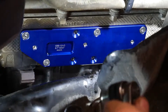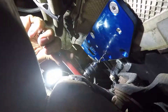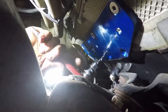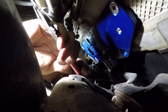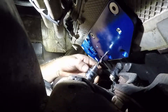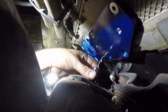Here I'm using a left-handed drill bit that I cut down, in that same drill chuck with a hand ratchet instead of an air ratchet, using a bar for additional leverage to push into the bolt and get it turning. The bolt is coming out. Since it's catching, I can take it out the rest of the way by hand. I'm leaving the template in place to keep debris from falling into the exhaust port — if that valve is open, that debris could enter the cylinder.